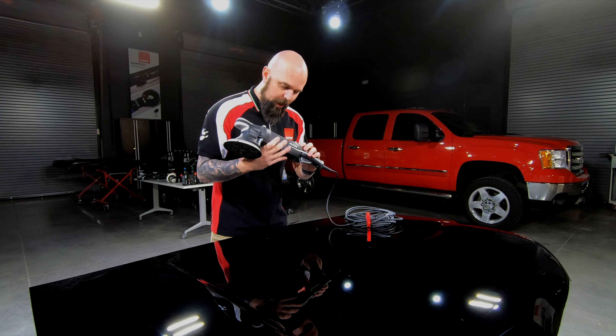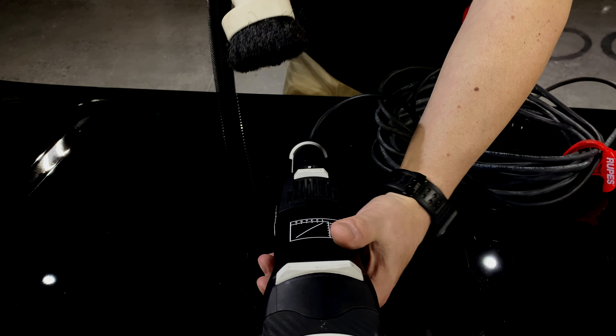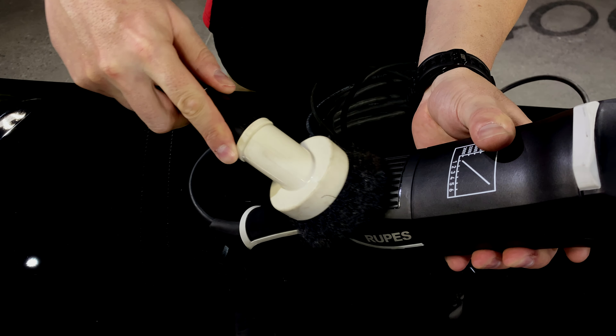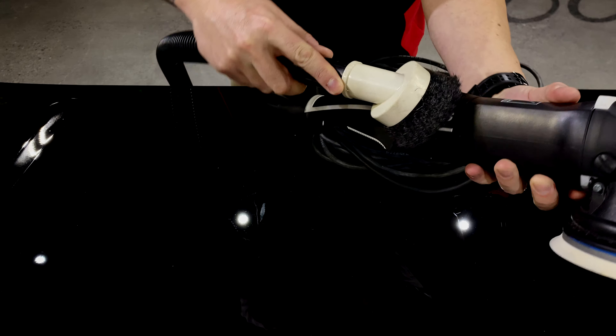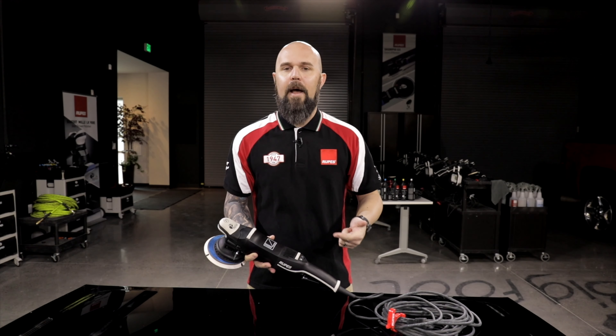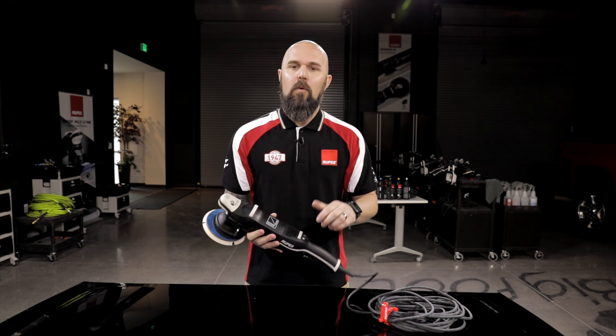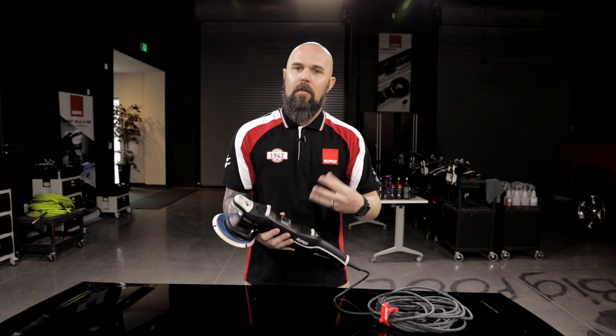The second thing you're going to want to do is take a vacuum brush attachment — your standard upholstery vacuum brush — and vacuum out these vents, top and bottom. These are the ones right around the motor, and they get clogged up. There are fibers from towels, from pads, compound dust, and all kinds of stuff flying around the shop that gets pulled in there. It clogs off that airflow and can cause the tool to heat up and not run at optimal performance. Every once in a while, grab that brush tool, put your vacuum on there, break it up, and vacuum that stuff out.